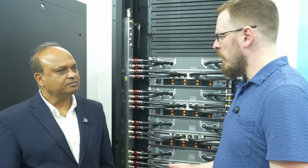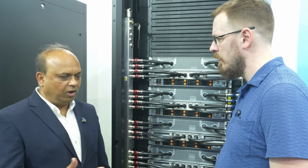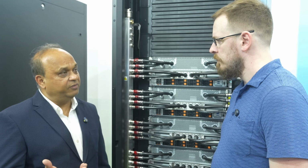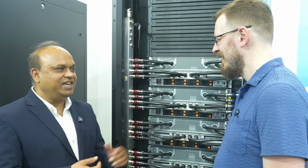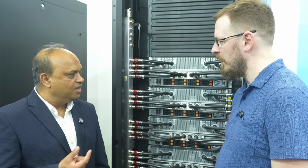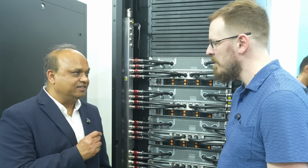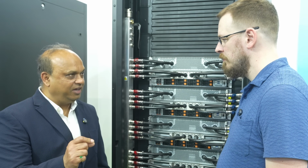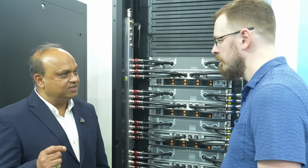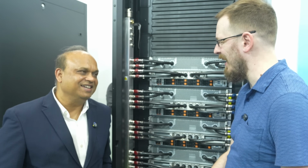Excellent. So when B300 launches, what kind of differences and improvements will we be looking at over the B200-based systems? So again, for all this stuff, everything is about GPU memory and memory bandwidth. These two things are very important. For HGX, the key difference is that memory plays a vital role. On B300, they call it one dual-die GPU per SXM. So over there, we are talking about 288 GB of GPU memory, that is HBM3E. And if you do the math, it is going to be 2.3 terabytes of HBM3E memory at a node level. Per eight GPUs, or per node? Per node. Okay, that's right, yeah.